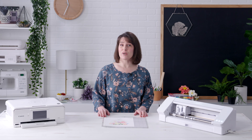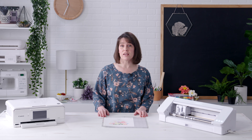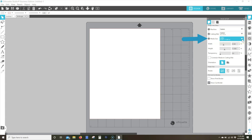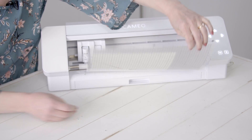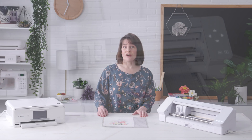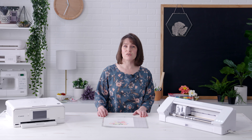Let's review common causes of registration failure. If you continue to receive registration failure messages, you should save the file, close everything, and start fresh. Make sure you've followed all the previous steps in order. Specifically, make sure you selected the appropriate page size and selected mat or no mat according to your actual setup prior to printing your job with registration marks. Check to make sure the mat or material is properly supported during the action where the Silhouette machine rolls your mat or material back and forth through the machine. Check your lighting conditions — harsh bright lighting above the machine as well as low lighting conditions can affect the optical sensor. Additionally, dark contrasting shadows over the sensor area may cause a failure as well. Even and natural lighting is best for the machine to read correctly.